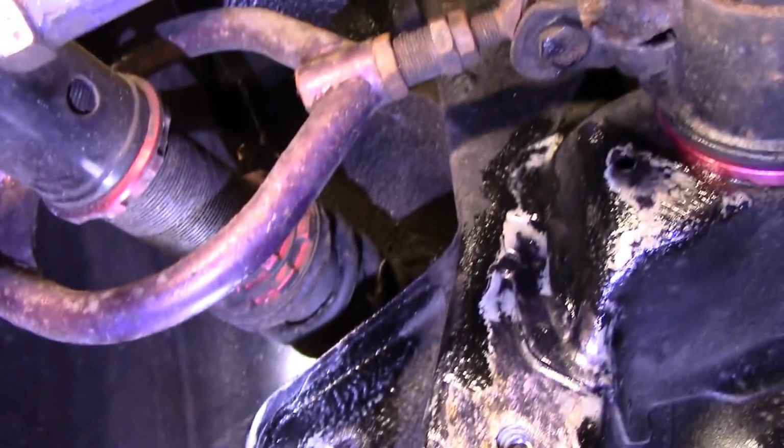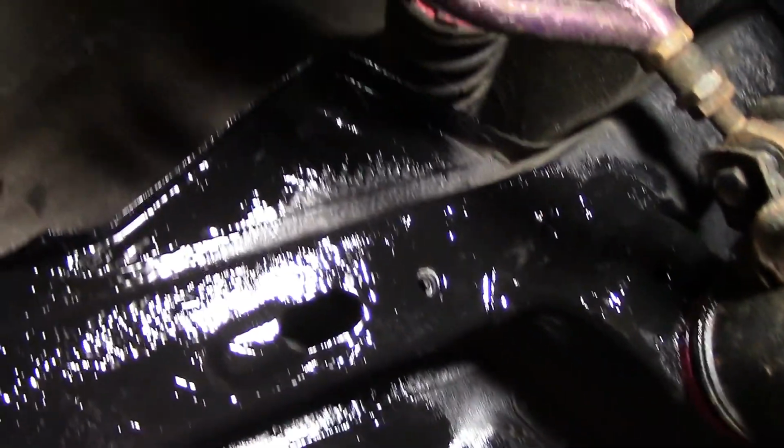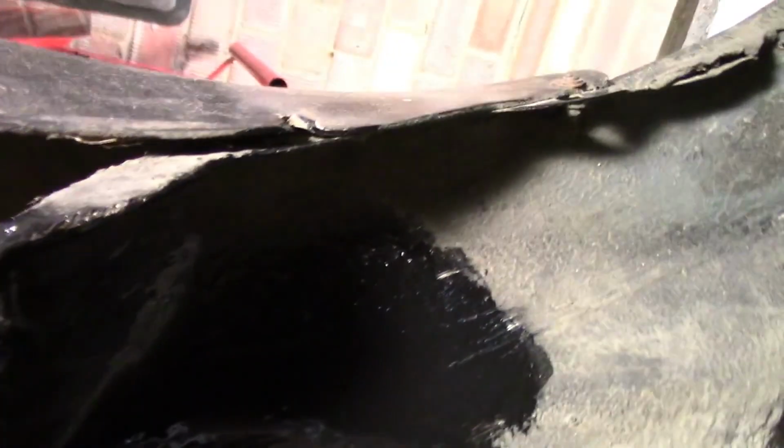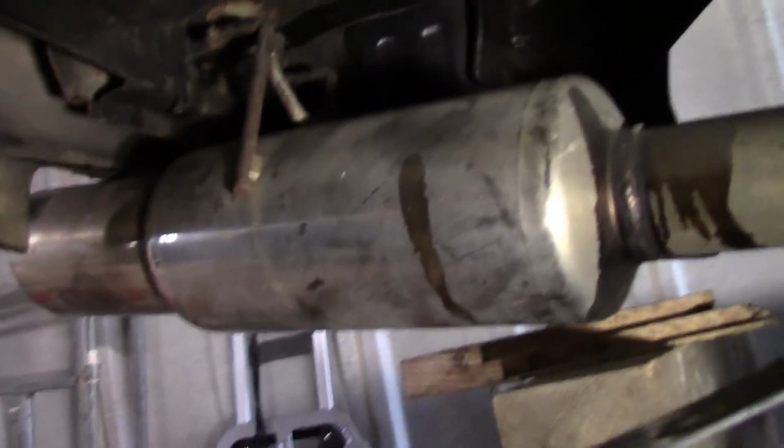So, now done, let's get proper paint on the starboard side. Painting's finished on the rear starboard, two coats of rust converter and then three coats of hammerite. Doesn't look really pretty, but solid and rust free, which is nice. Done the best we can. It's quite hard to get into all the nooks and crannies with the power tool, so done the best we can, like the rest of the car, working on your back. So that's that lot. Next, we're going to remove the exhaust and work on the port rear side and get that up to scratch.